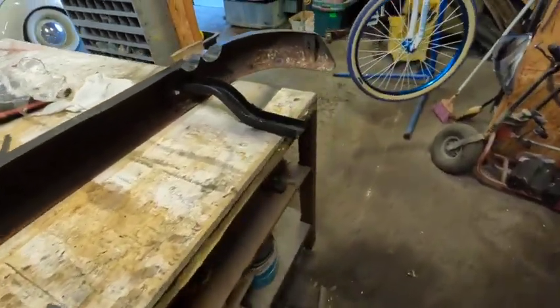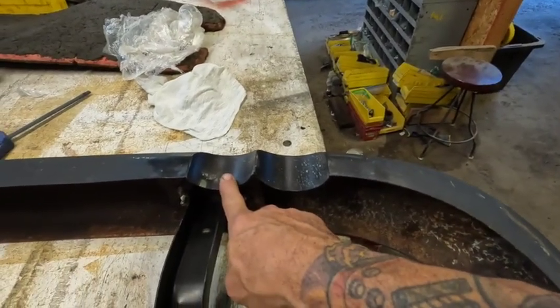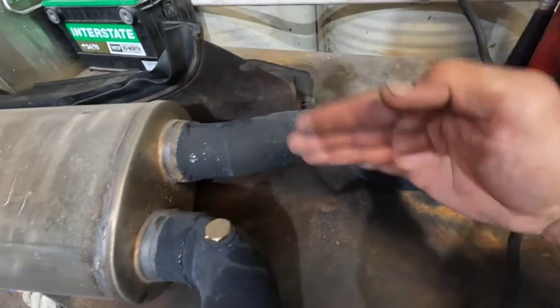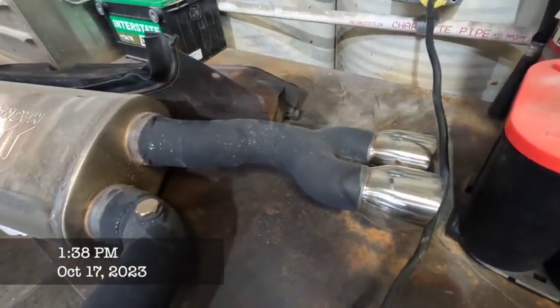Another item I'm going to be addressing — when I did this modification on my bus for my exhaust cutout, everything lined up perfectly until it went through its first heat cycle, and then my tips did a little bit of zigging and zagging. If I do one slit on the side and just move it over to where it lines up again and then re-weld it, hopefully it gets where I want it to be.